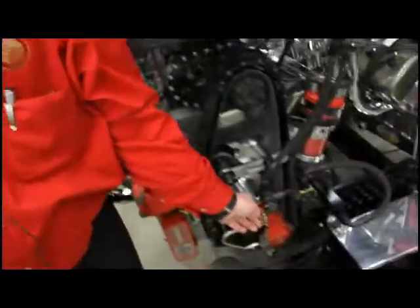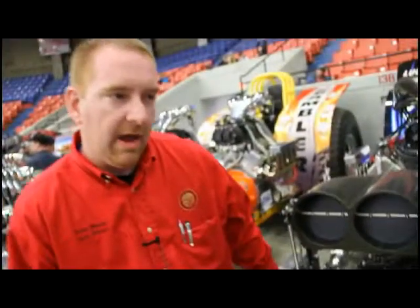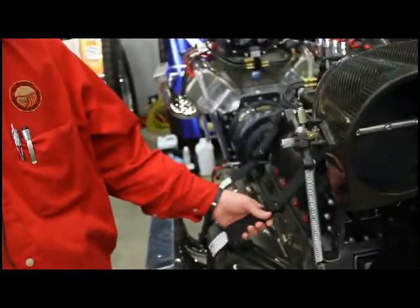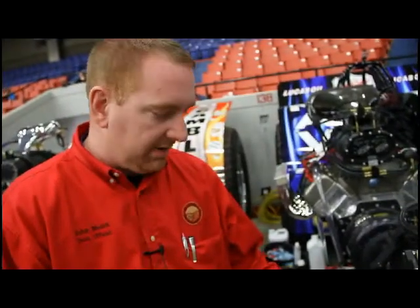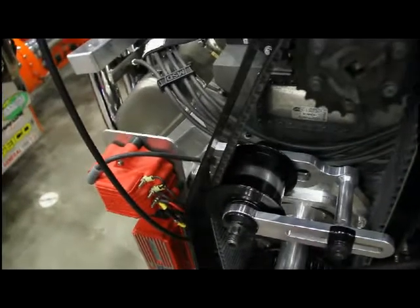We also check the fuel shut-off to make sure the fuel will be shut off in case of emergency. Additionally, there are blower restraints — so if a supercharger were to lift, it's not going to go into the air; it'll just pop, and these belts on both sides of the engine will keep it close to the engine block. And as you can see right here, the burst panel is another safety feature built into the intake, so in case of a backfire, it will blow and not cause a big hole in the engine block or tear a lot of parts up.